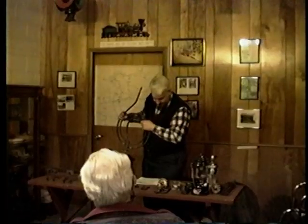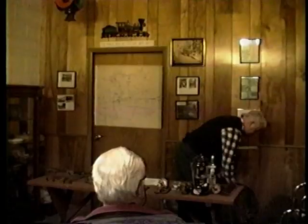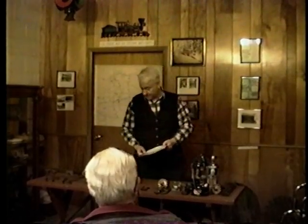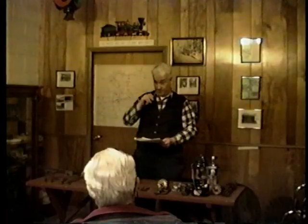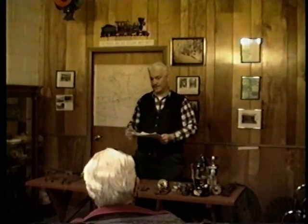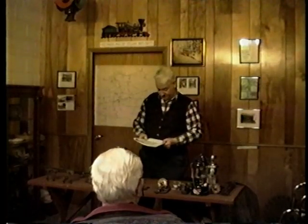And the nozzle sizes they changed again, and if you compare them to the other sizes, they're about 2 sizes bigger. And then they had to put a firing up valve on because they had a separate system for the main burner fuel, and the main burner needed to be heated up pretty good before it would burn kerosene. So they put a firing up valve on it, which put pilot fuel, which was gasoline at the time, into the main burner. And since that vaporized faster, that would tend to get the burner going, heat up the burner, and once that heated the burner up, then you could start putting kerosene in there, which by that time was warm enough after going through this long vaporizer to burn. And if we have enough time and get into the firing up process, we'll learn all about that.